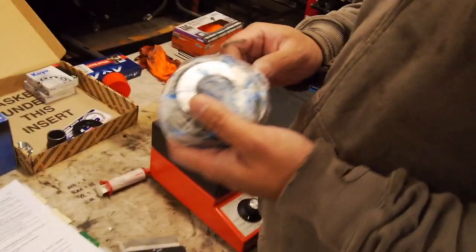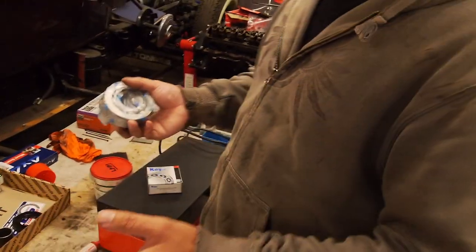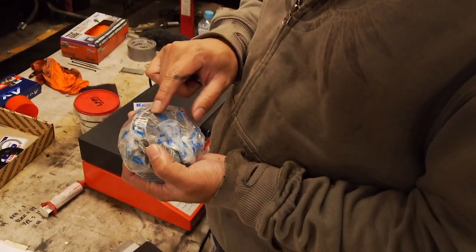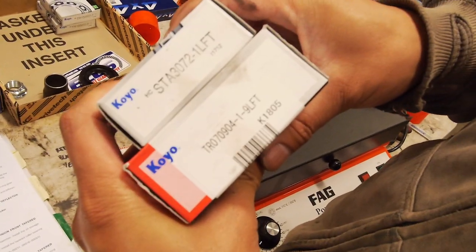Yeah. So if you haven't seen the previous video, we basically realised that we had a 120 Prado pumpkin and obviously bearings, which are bigger, which is a good thing, but it meant we had to order extra gears. Well, the gears were ruined anyway, so we had to do that, but a couple of weeks have elapsed. And these two are the pinion bearings. So in this particular design pumpkin, they've upgraded the pinion bearings to a heavier duty bearing. You can see it's quite a lot thicker section. Those are the two pinion bearings.